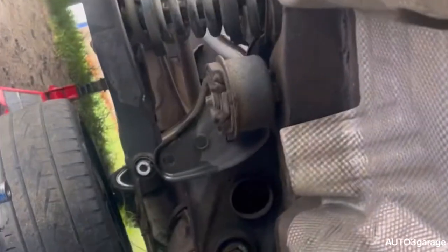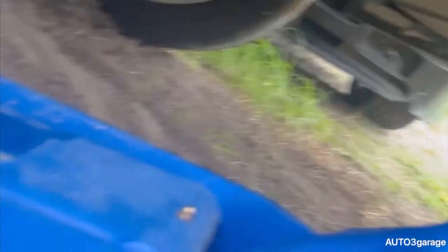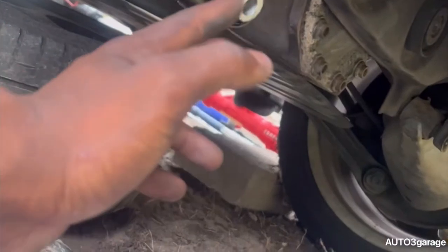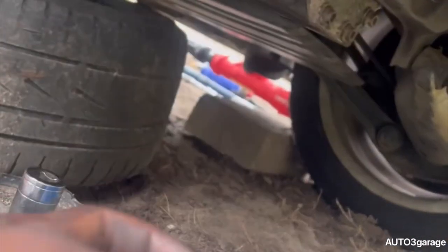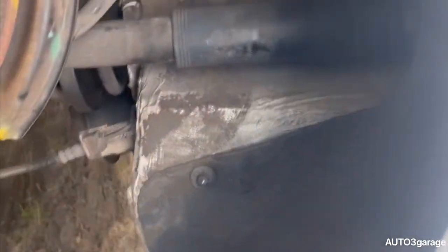I'm doing the rear brakes and brake pads, and I'm about to change out the spring and put in the rear spring. What I had to do is loosen the bolt a little bit and use a socket with my jack to hold against it so when the bolt loosens it stays in place and I can slowly bring it down. I also had to compress the spring before taking it out, then loosen and bring it down. The transformation is coming.